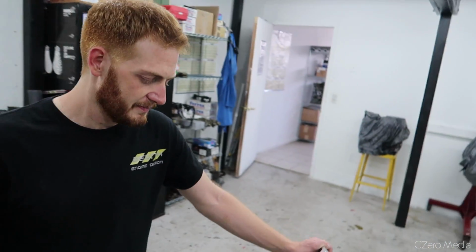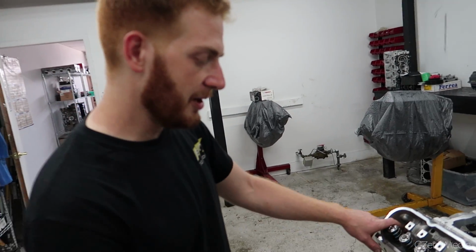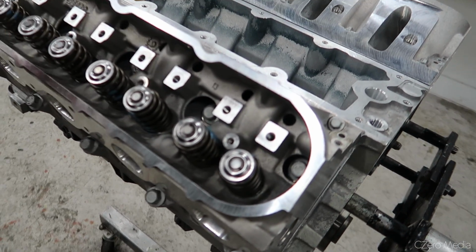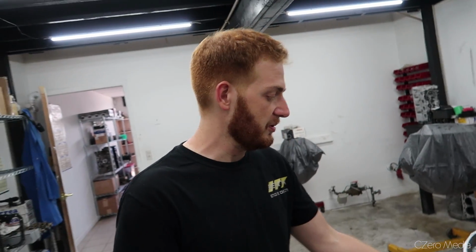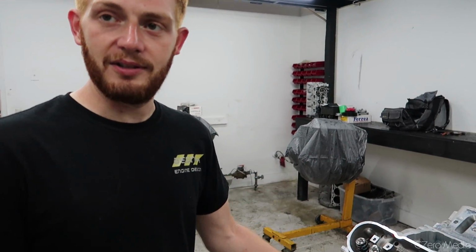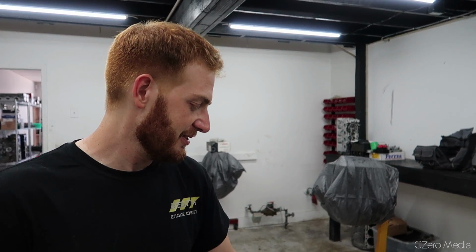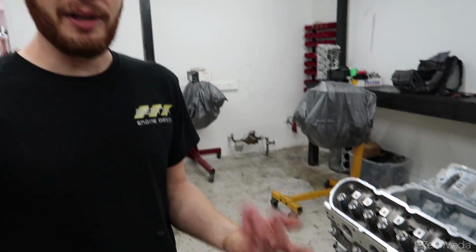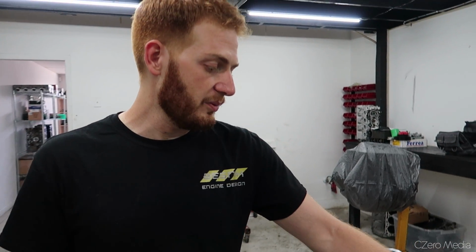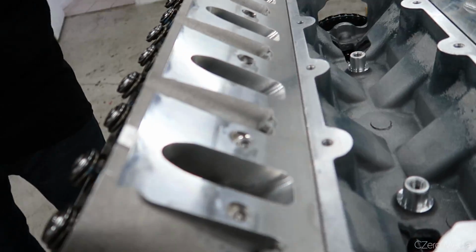So, what are the torque specs or torque sequence? The torque sequence, actually, there's three or four steps. If you remember these two bolts on the inside of the valve cover area, they were shorter compared to the rest of them. Basically, all the inner bolts, all these long ones, the M11 thread diameter, get torqued to 22 pound feet initially. And then all the longer ones will get torqued an additional 90 degrees. And then these medium length ones get torqued an additional 50 degrees. And then these small ones here get torqued at 22 pound feet.